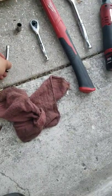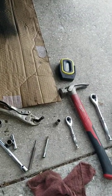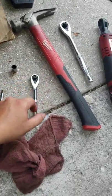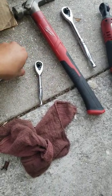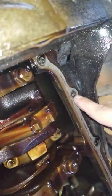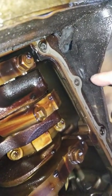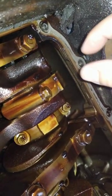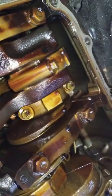Now let me tell you about the bolts from the bottom. We have the quarter-inch ratchet with the extension and 10 millimeter socket — this is for one tricky bolt in the back. I'll show you where it goes; there's a bracket back there that you do not have to remove. When you have the oil pan in place, this bolt is kind of super tight against the bracket. Use that 10 millimeter with the quarter-inch ratchet to loosen it, and the rest you can get with your fingers. Then put it back and tighten it the same way.